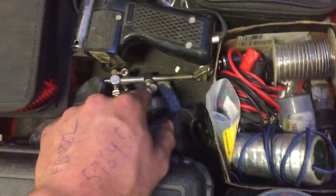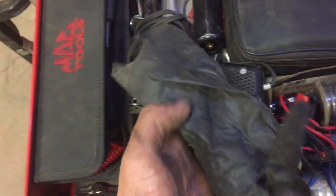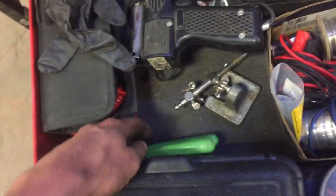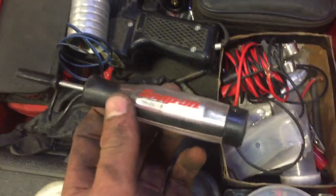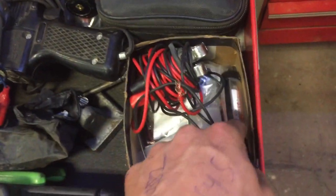A little third hand for doing small soldering stuff — alligator clips in here somewhere. Rubber glove with my tube of dielectric grease that I forgot the cap for. Snap-on wire strippers, crimpers, and cutters — absolutely love these, way better than my channel lock one. Just a bunch of generic stuff, a little bit of solder. This is my continuity tester that I made in high school. Some little alligator clip leads for load testing circuits. And this is another snap-on gimmick — the wireless test light. You actually act as a ground, but this thing is so sensitive and it doesn't put any load on the circuit, so it's just more of a gimmick than anything. Don't buy it, waste of money.